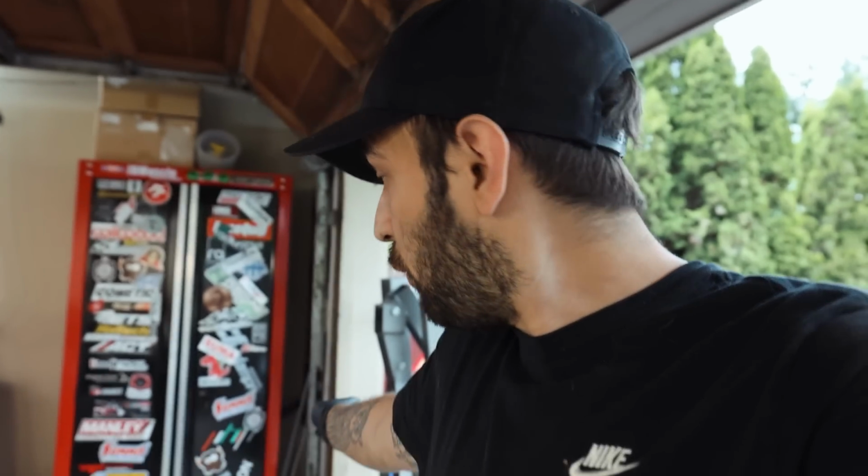Holy hell, dude, that was probably one of the worst engine installs I think I've ever done. And it wasn't the fault of the engine, it was the fault of the hoist that we have. We have a Pittsburgh one, and the engine bay is so long in the RX-7 that our engine hoist's arm isn't long enough. So it was about 2 to 3 inches short of reaching the bell housing.